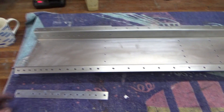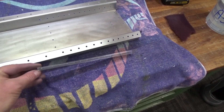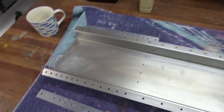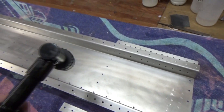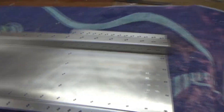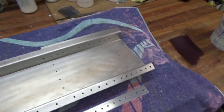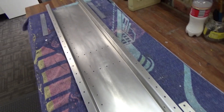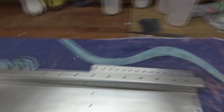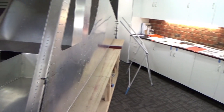For the landing gear channel, I found it easier to do the doublers with the channel removed from the aircraft. I used my $20 right-angle drill from eBay just to get in there and get those bolt holes — that worked out well. Just about to rivet this up. Nice little jobs one at a time, all cleaned and primed. Then it gets added to the forward fuselage which will join the rear fuselage and cabin frame.